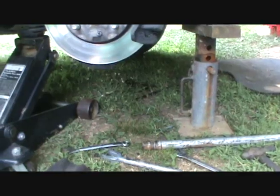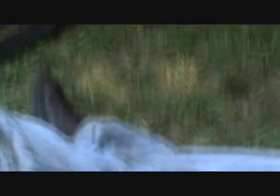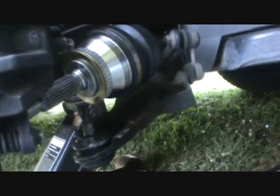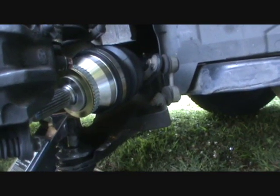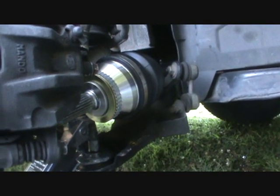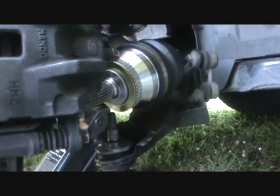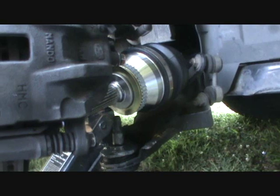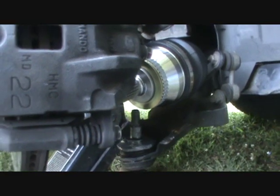I'll include video of doing that. Now it's just a matter of unwrapping the new axle and putting it into the transmission the same way the old one came out. The new axle is in the transaxle — you just slide it in and wiggle it around until it seats all the way. You'll know when it's in. Eyeball how far in the old one was and match that with the new one.